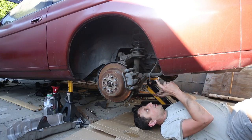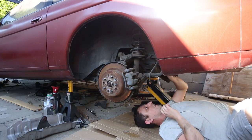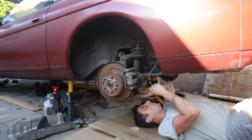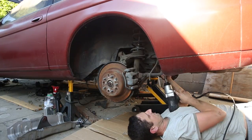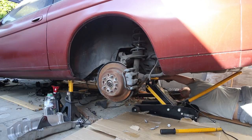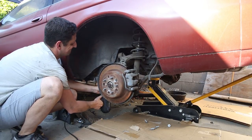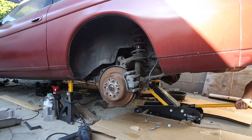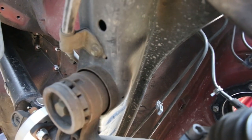Both brake lines are undone and the struts are undone on top. So now I should be able to take off these eight bolts holding on the mounts and then the two big bolts up top and drop the whole thing down on my jack. With the subframe lowered I can get my hand up there and pull all of these gas lines out.